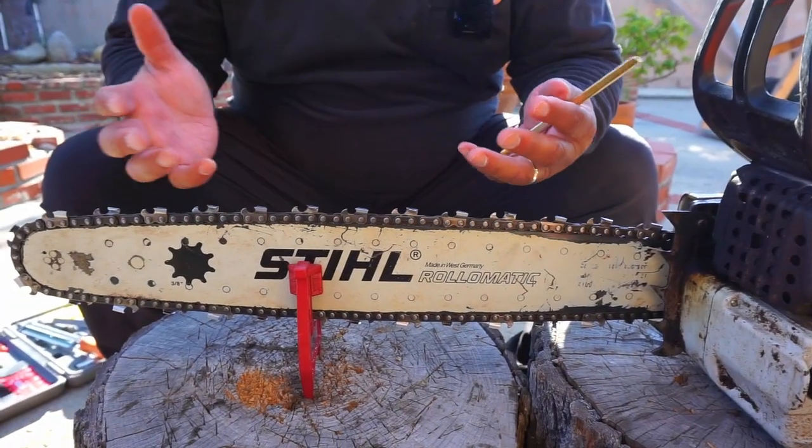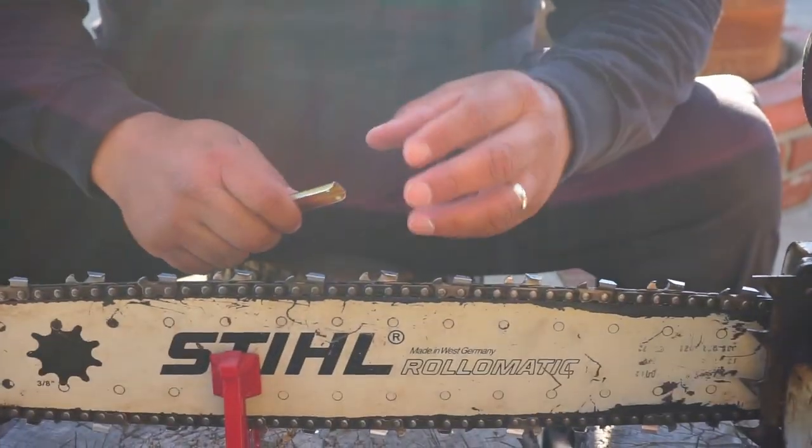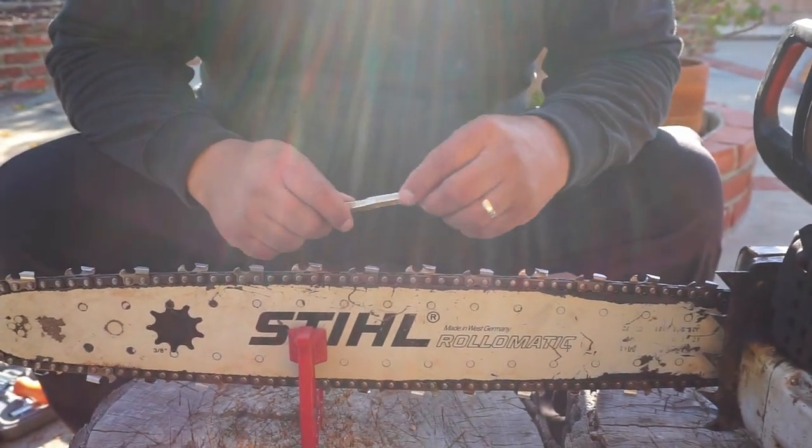Now I've completed all the cutters and depth gauges through the whole chain — just a little bit was taken off the top. Having a good sharp chainsaw means it'll cut through wood better. You can tell when you need to sharpen by what you see: when using a chainsaw you should be seeing shavings of wood. If you start seeing sawdust or powder, it's definitely time to sharpen your saw. Well, there you have it — the way I sharpen a chainsaw. That Oregon chainsaw sharpening kit is a really cool kit for an inexpensive price. A properly sharp chain pretty much cuts itself — you don't have to push and force it. If you're forcing it, more than likely you need to sharpen. Hope you guys enjoyed this video — comment, like, subscribe, hit that notification bell, and share our videos with your friends. Take care, we'll see you next time.